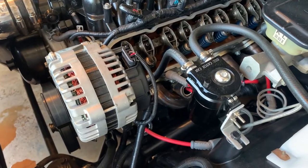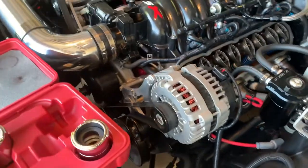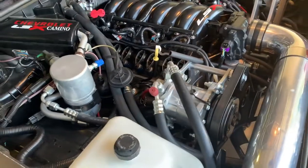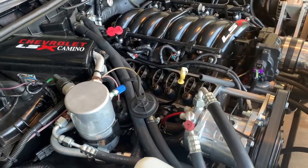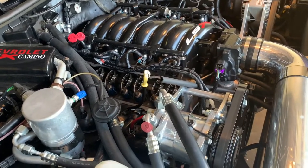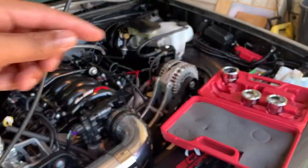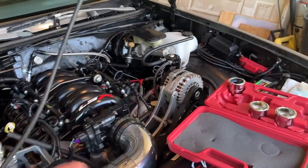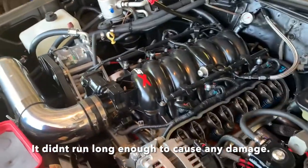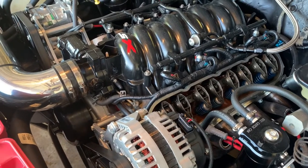There may be some sludging, but I'm sure the bearings won't be washed out. I'm going to go the extra mile — when I get everything changed over, I'll do a couple of oil changes and keep my eyes on any additional murkiness in the oil. I'll use a Q-tip inside the oil fill hole to wipe around and see if I've got excessive sludge, then probably run some kind of engine flush to clean it out.